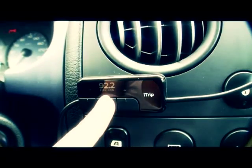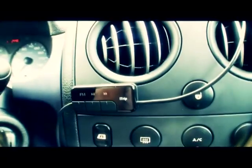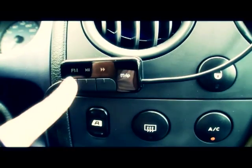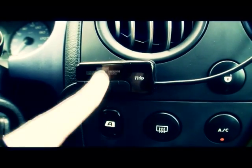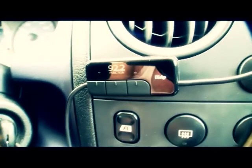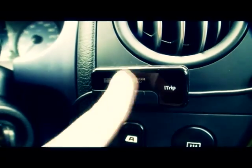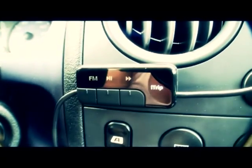Another thing that isn't in the manual: if you push 'function' for a little while, it shows you the software version and everything about this iTrip model. But as I said before, if you want to have the remote function on this iTrip, you have to make sure that the Griffin sign is not lit up. If it's lit up, you will not have the possibility of the remote function. So I keep it that way and then I can use this as a remote as well as the plug.